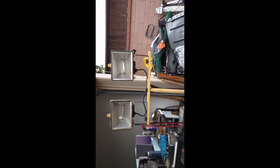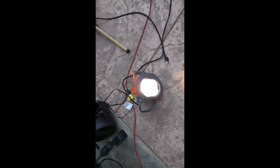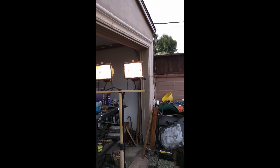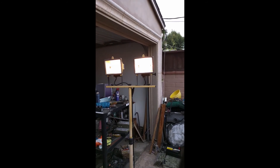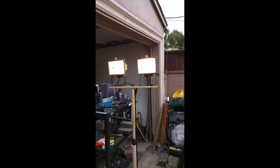If you want you can also use a bigger light with two bulbs, like this one here — this is 1000 watts, also from Home Depot. But I think the 600-watt light does a good job, especially for this car since it's a small battery. This is how you use the discharger to discharge a hybrid battery. Now here I'm using a twin light, again from Home Depot, just to show you that with the discharger I've made you can use both the single light or the double shop light. I will put the link for these lights if you want to buy from Home Depot.